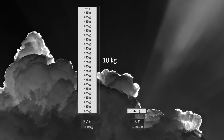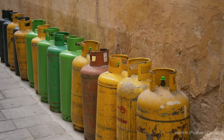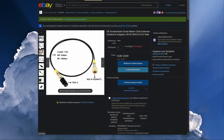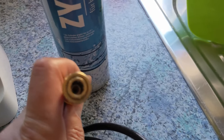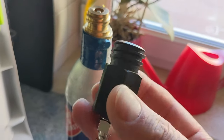In addition, you have to pay the deposit for the large gas bottle and you need an adapter so that the gas bottle can be connected to the Sodastream device. This is available for around 28 euros. The German gas bottles have a W21.8 by 14 connection. On the other side there is a quick connector that is connected to the Sodastream compatible adapter.